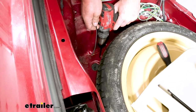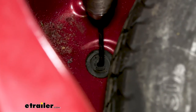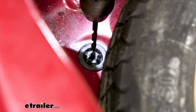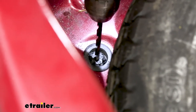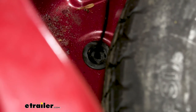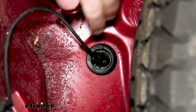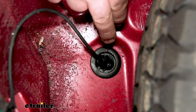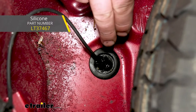Now we need to get the other end of our power wire outside of our vehicle so we can connect it up front to our battery. It turns out there's a grommet right here, and what I'm going to do is just drill a hole in that grommet. You may want to check underneath there to make sure there's nothing of importance — the only thing there is a plastic shield underneath our vehicle. So I'm going to open that hole up, take the end of our wire and feed it down through the grommet. Once you push everything down, come back with some sealer and seal that up so nothing comes up through into the trunk. I used some RTV, and we do carry that here at E-Trailer if you don't have any at home.